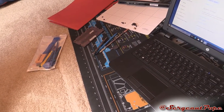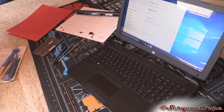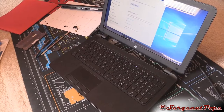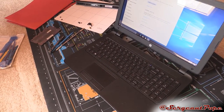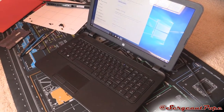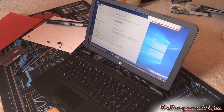On top of the screen being broken and the CMOS battery being totally broken off the motherboard, the hard drive was toast as well. I haven't seen a hard drive this bad in a while. Windows would obviously not boot. I put a hard drive in here from one of my old PCs — just gave her a used hard drive that I formatted and deleted all the content off of. Windows had the shittiest time installing on here. I think it's because the BIOS settings were kind of messed up, probably because that battery wasn't in there. So I had to fix some BIOS settings and kept tinkering around with it forever. Finally got Windows 10 in there, and it activated, which is great. Got some Windows updates in there as well.